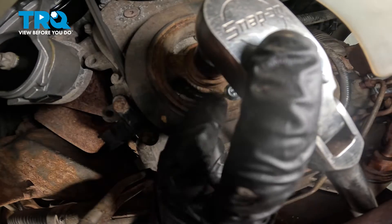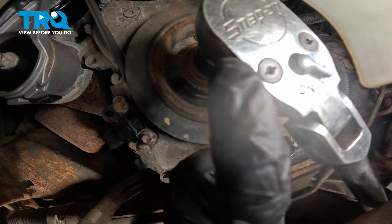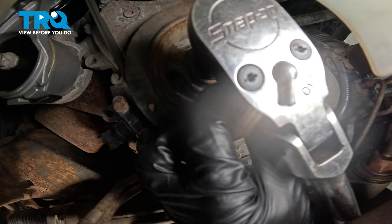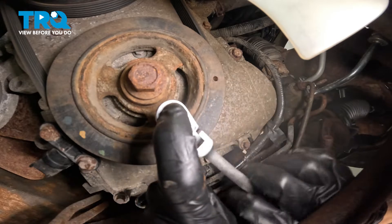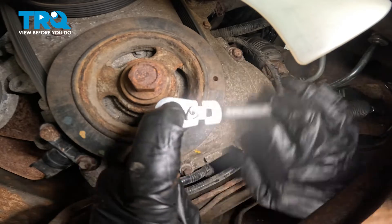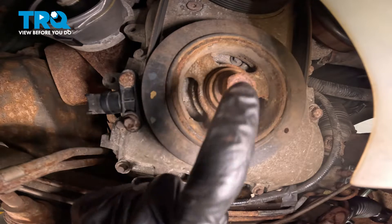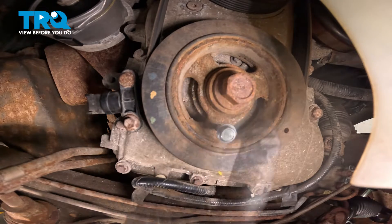We'll be paying attention inside this area. Since I can hear compression, I know I'm on a compression stroke. Looking through the large holes in the pulley at the timing chain cover, I can see that mounting bolt hole — it's pretty much in the six o'clock range. Continue turning the crank pulley until that bolt hole lines up, then put in your M6 mounting bolt. The bolt has dropped in through the hole of the crankshaft pulley into the hole in the timing chain cover. Confirm that the bolt is directly below the crankshaft pulley bolt.